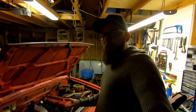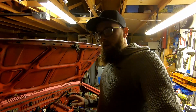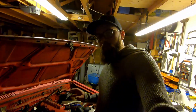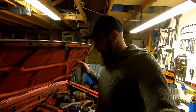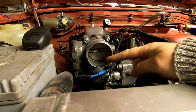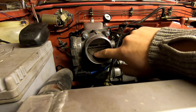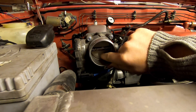I've been troubleshooting the throttle body for a little while now, because I thought I had everything adjusted correctly. But once I fired it up the engine would just rev up to around 3000rpm and stay pinned there — I could not get the revs any lower. It turns out, if you look at the throttle body now, this is its resting position and it looks closed but it's actually not. There is a tiny little gap — if I push it, it will go a little bit further in to fully close.